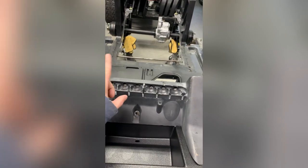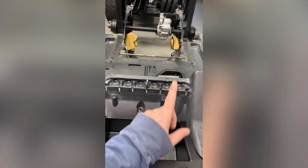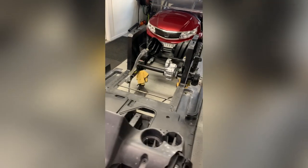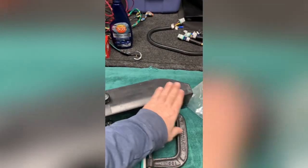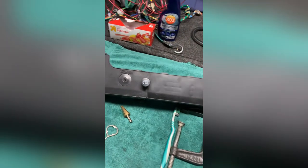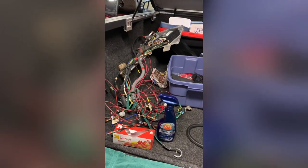I did put a fuse panel in that one — all the accessories go into a 12-volt fuse panel first, and then I run the accessories off of that up into the dashboard. The fuse panel is mounted to the dashboard behind it. I think I might have mounted it right here — it still fits because with that double-take dashboard you do not put this whole thing back in. I might do a texture spray here too, just to make it look fresh and hide the digs that are in it. We'll cross that bridge and try to cover that in a future video.